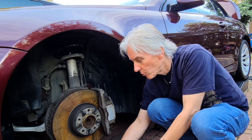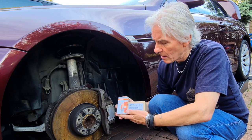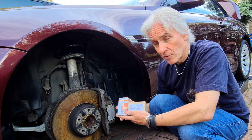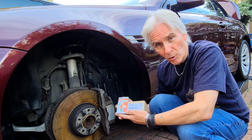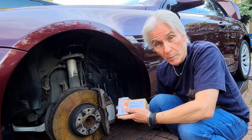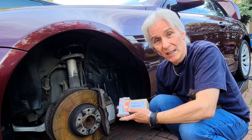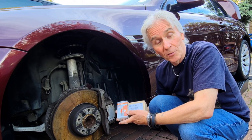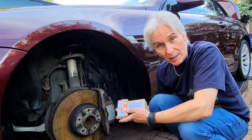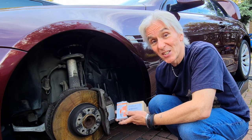The D2S is the bulb for these six series, and part number 63126919886 is for the igniter. This is for a 2007-2008 model — at some point they used a different igniter and a different method of putting the bulb in, which isn't explained at all in the TIS. Thanks very much for watching, thanks for subscribing, and thanks for all the comments. Put a thumbs up if you like the video and I'll see you next time.